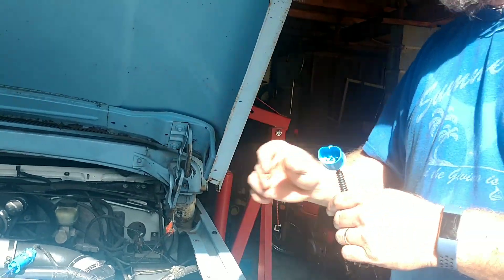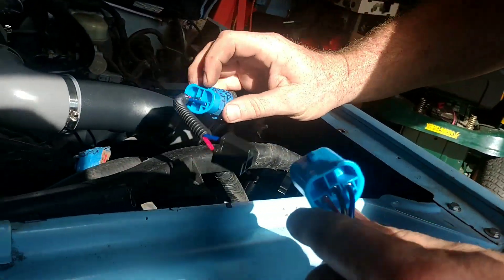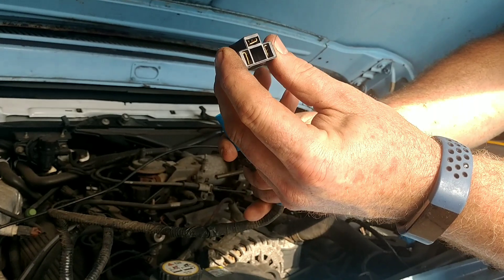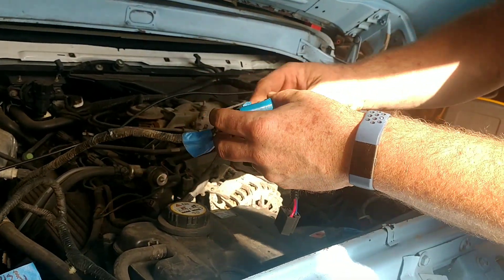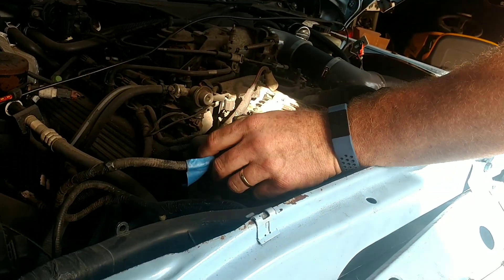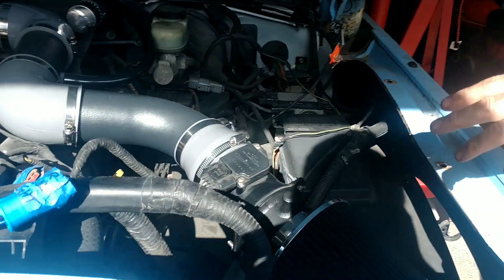This little item snaps right in — I've already snapped that one into the Crown Vic headlight, and you just click that in and it'll go to the original truck headlights. That is part number 9007 to H4 connector. I got those off Amazon for about 10 bucks. It just snaps in so you don't have to do any splicing or anything.